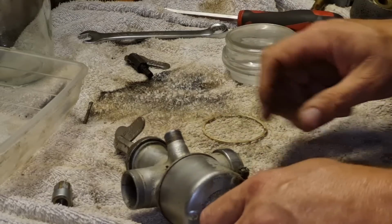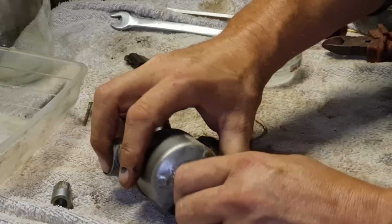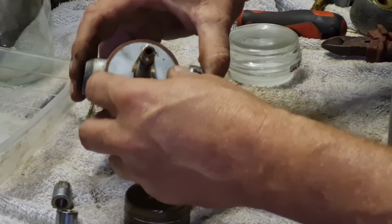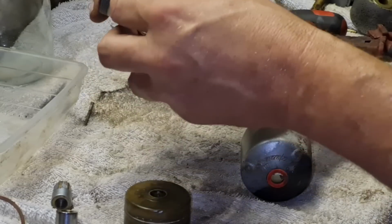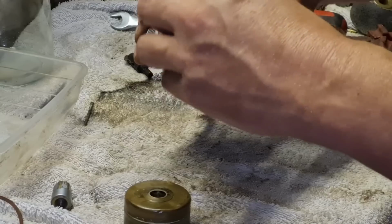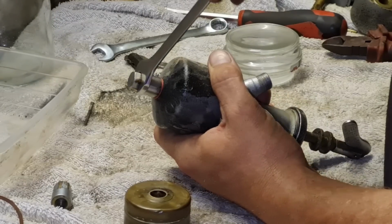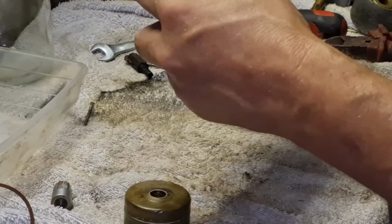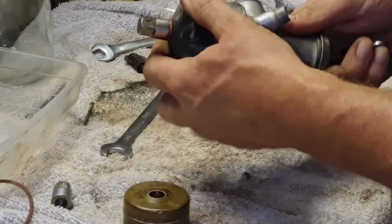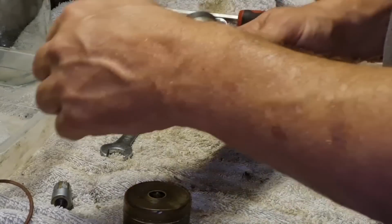I am going to replace this good gasket actually, because the old one had a split in it. See, this gasket here got a split in it. Let's put this good one on. There we go. Let's just nip him up. There we are. How's that gone on there, right? That carb bowl doesn't look right to me. That don't look to be sitting right.